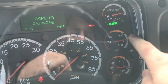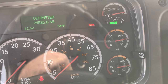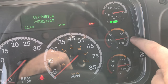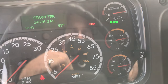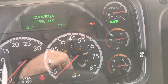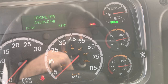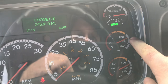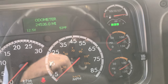When we release the brake, we're going to see our pressure fall just a little bit and then stabilize. When it stabilizes, we start a one-minute count. You're looking for no more than 2 PSI fall. Keep your eyes locked on that gauge and tell your instructor you are watching the gauge fall no more than 2 PSI during the one-minute count. We release the park brake, watch the gauges fall, and they stabilize — now you start counting.